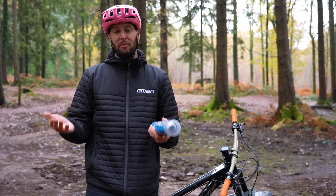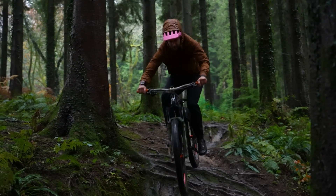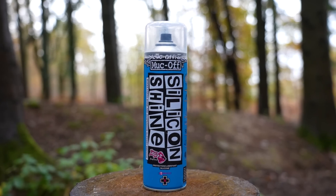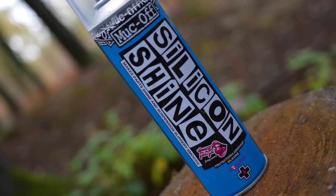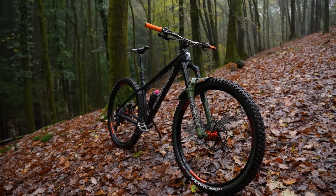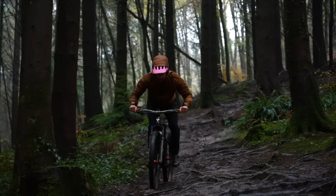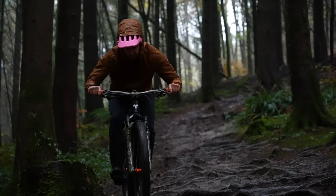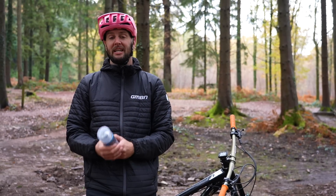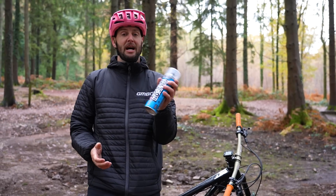We all know that the wintertime means muddy rides. Muddy rides means more cleaning. Anything you can do to make cleaning your bike and your life that little bit easier — well, it's got to be a good thing. Something like this, a silicone-based spray — silicone shine from Muck Off in particular — you actually just spray it on your bike and it leaves a film, a coat on your frame and other certain parts, that stops the mud sticking as easily. Then when it comes to cleaning, it just falls off a lot better, making your life quicker and simpler. However, I will warn you — any products like this are lethal on brakes because it can contaminate the discs and the pads and they ain't going to work. Do be careful when getting trigger happy with the tin.